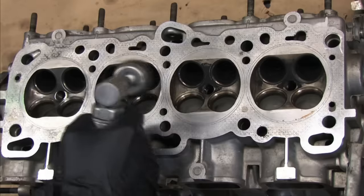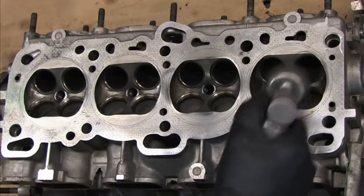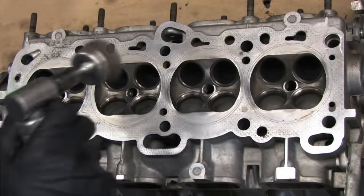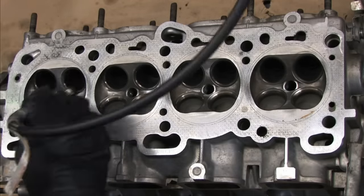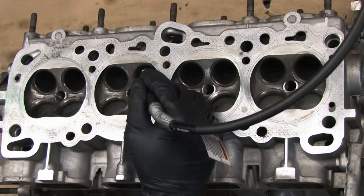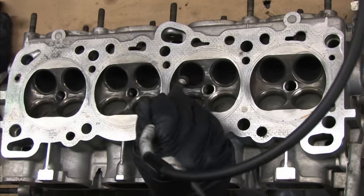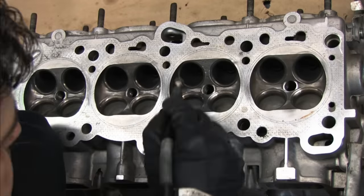I really didn't want to have to do any of what I'm about to go through on this head, but it's already off the car and completely disassembled, so this is the only logical opportunity I will see in the near future. Boosted high compression engines are theoretically prone to knock, which is pre-ignition of your fuel source. Knock is relative to the stability of your fuel. As a fuel mixture is compressed, its volatility increases.